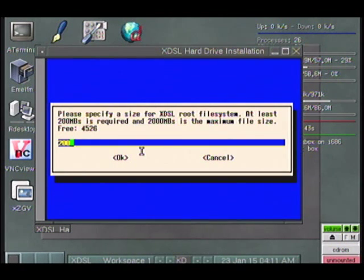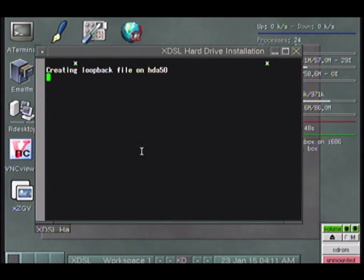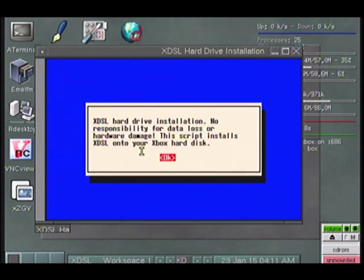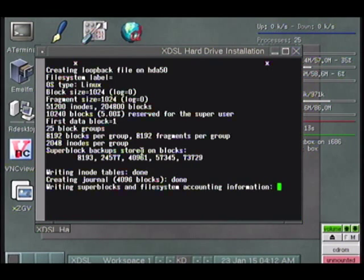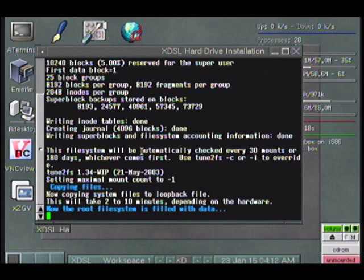Press X to the next file. Please specify a file size — I'm going to leave it at 200. It's now creating the loopback file so that we can load it off of our Xbox from the hard drive. Last chance to exit — do you really want to do this? Yes. It's probably going to overwrite my old file, but that's okay — we just have to change two little things. I'm just going to leave mine on the E-partition, because I don't really use it for anything but apps, and this is an app. You can do whatever you want with it, assuming you have already upgraded your hard drive with LpartX or Chimp Cloner. E-partition, F-partition, D, G — whatever you want to use.